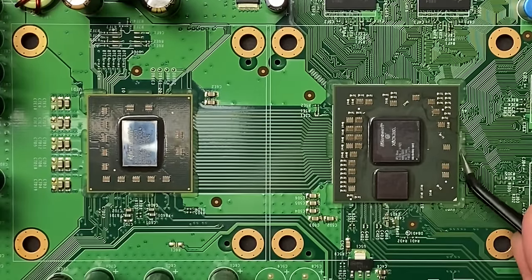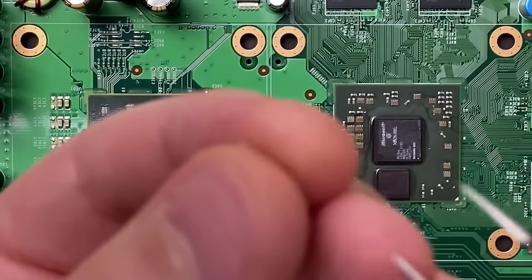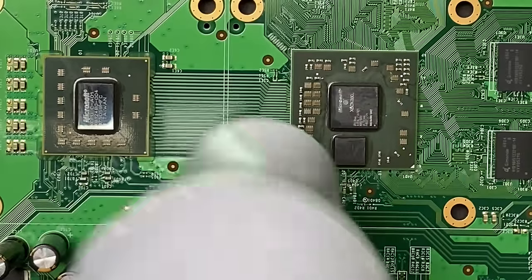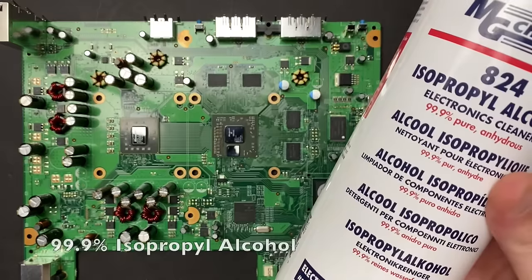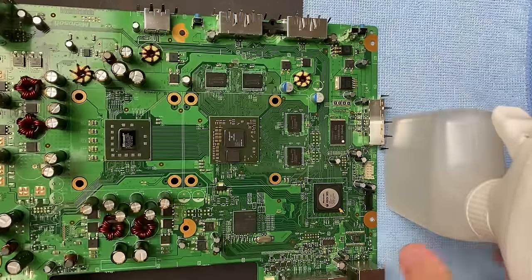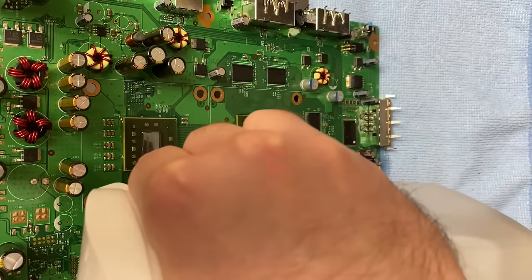You're not going to reflow your GPU with a hairdryer — the hairdryer only outputs 200 degrees, and remember, we need to hit 425 for anything to start actually melting. It will, however, enable you to remove all these plastic anchors surrounding both chips. I would have thought every reflow video out there would instruct you to remove these, but in fact none of them do. I don't trust that these plastic tabs are as perfectly aligned as they were the day the Xbox came off the assembly line. Even if they're off by just a hair, they're going to interfere with the inertia that tries to pull the chip to the right place once all the solder balls are molten underneath.